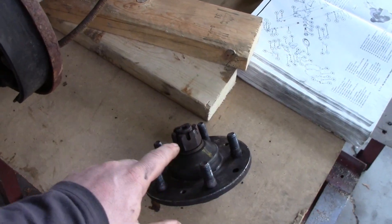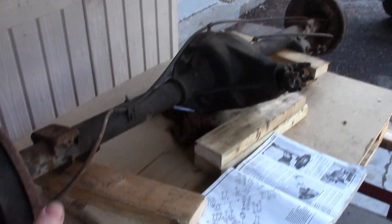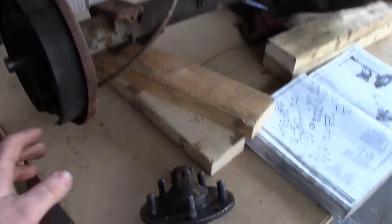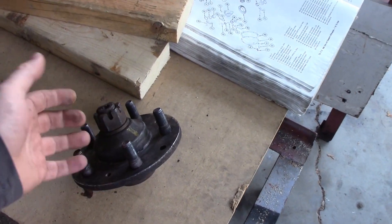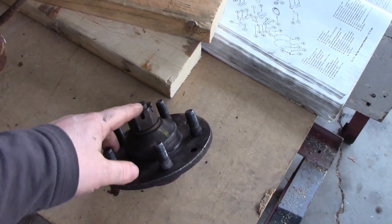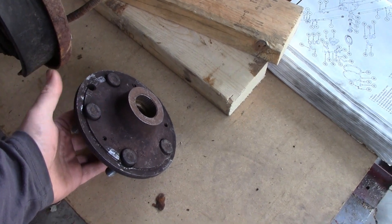As a result, the threads on here are stressed super hard — it fatigues the metal. And once that happens, even after you've loosened off that nut and retorqued it correctly, the shaft is already condemned — it's already fatigued and broken. This one here lasted another two years before it snapped.